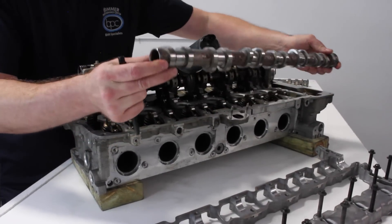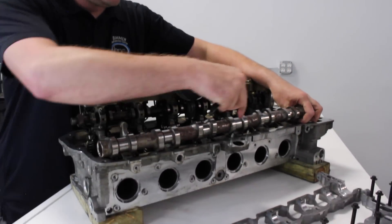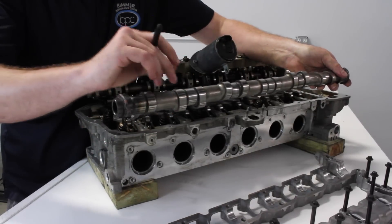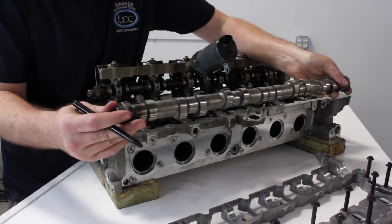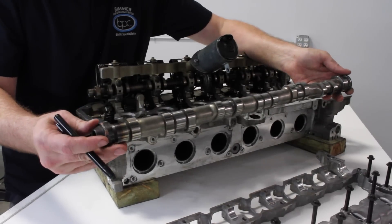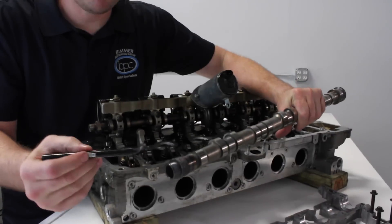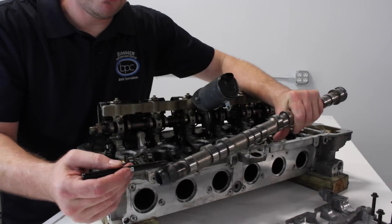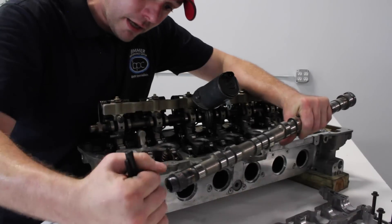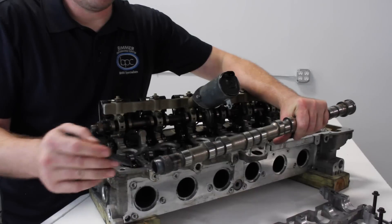You can see what we have here — what BMW calls a hydroformed camshaft. Basically it's a hollow steel rod, lightweight, and the cam lobes are slid on. They expand the camshaft to press against the lobes. I've never seen one fail in the field — it accomplishes the job real well. We've even welded on this last lobe here; we TIG welded all the way around until it was glowing red, then took the cam and hit it hard down on our welding table, and there's zero movement.